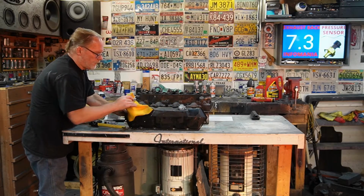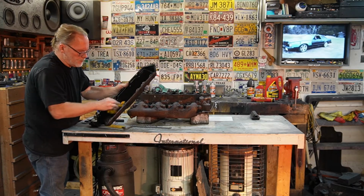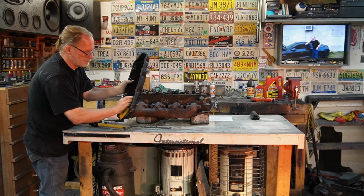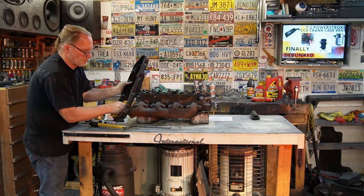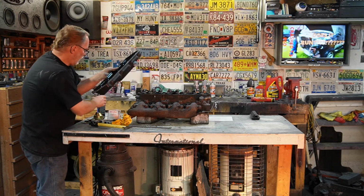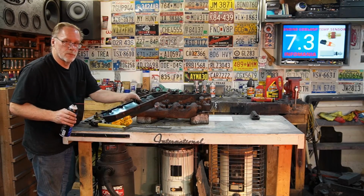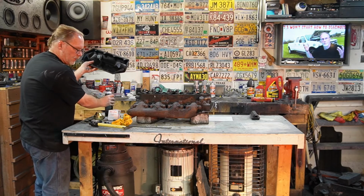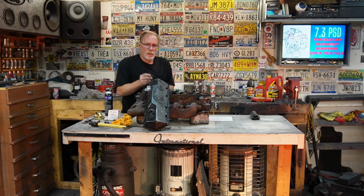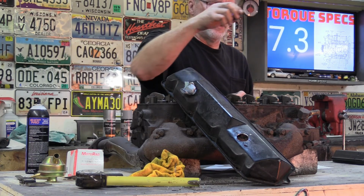So then from there, clean off all of your excess. Get all of the nibs and little chunks of metal out of there. Go ahead and go outside or get yourself protected, get everything brake cleaned again, do a real good job. We don't want to have any of this metal going down inside here. These have a direction. Basically, you have a pointed wedged end that's going to go down.